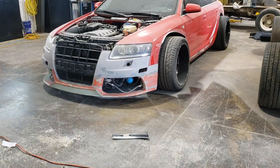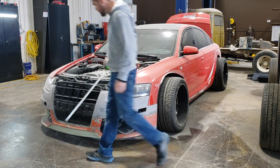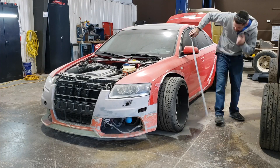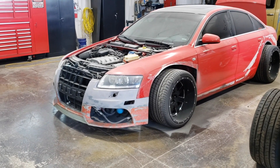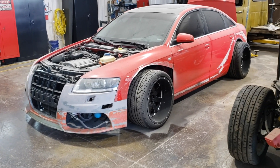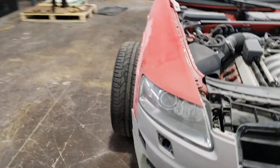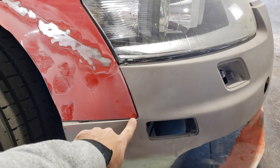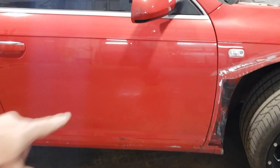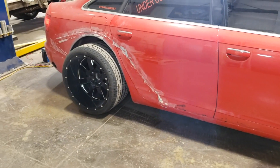I get the suspension set to what I think is ride height and then go around with a tape measure checking a bunch of different points on the car to see if it's sitting level and equal. One of the issues we had last time was making sure we got everything square and equal side to side, front to back. So this time I took a little extra time to measure some key points that haven't moved, like the bottom corner of the fender to the ground, the mirror to the ground, and measurements off the back at the taillight area.